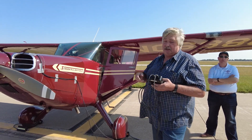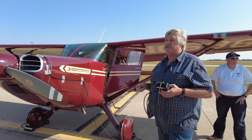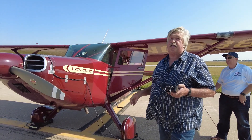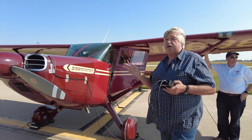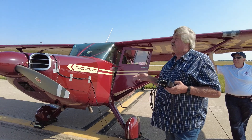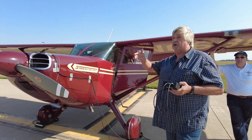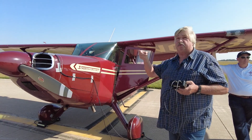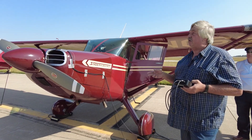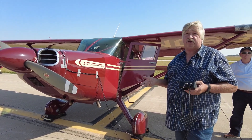My airplane — the brown one — I messed around with it, I get a little over the top. I'll leave this on it, go fly and set an in-flight cruise to get the RPM down. The azimuth angle changes a little bit but not that much. I've been doing this for 45 years, started out with the first generation equipment — a strobe light and an analog gauge. I've yet to have anybody who could not feel the difference when they do the airplane.